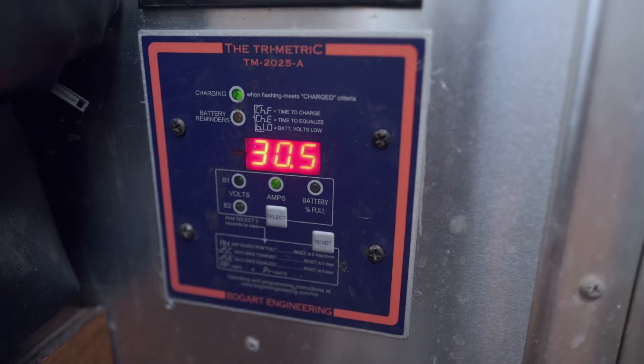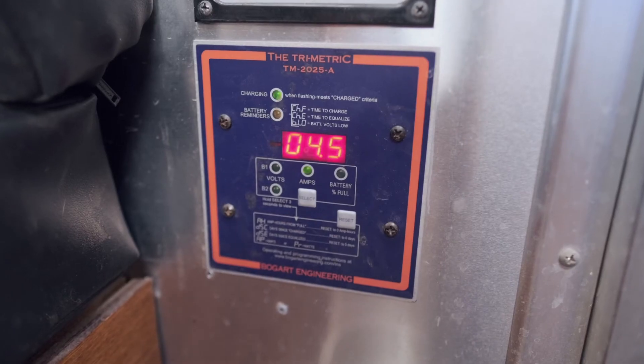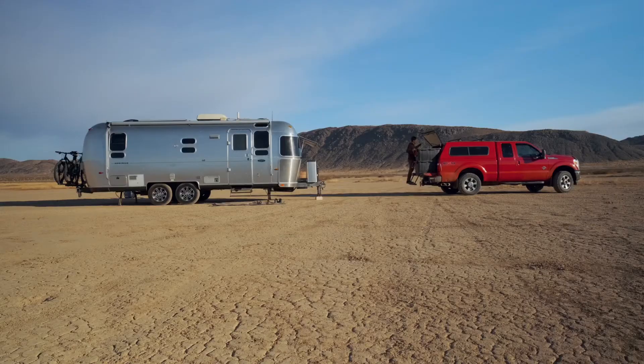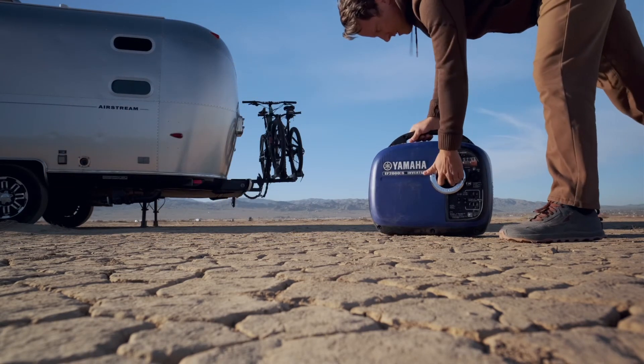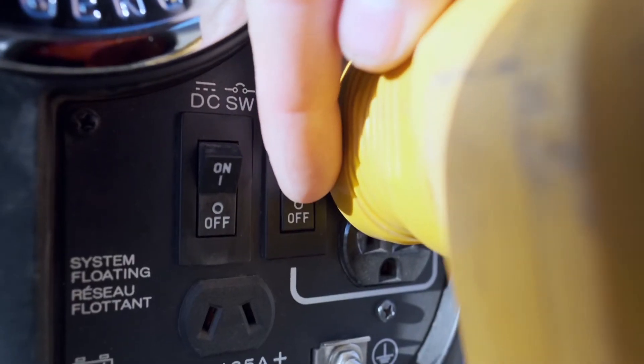The good news was there was plenty of sunshine in the desert, so with our 520 watts of solar panels on the roof we shouldn't have had a problem recharging — but we were wrong. With AGM batteries, there comes a point where it doesn't matter how many watts of solar you have, because they only rapidly charge until they're 80% full. After that they require a long, slow absorption period. You can see on the meter: in the bulk charging stage the batteries are taking about 30 amps, which is great, but after a short time they absorb less and less — at 94% full we're only taking about 4 amps. At that low amperage it takes about five hours to bring the AGMs back to 100% state of charge. In winter, the days are just too short and too cold to make up that energy deficit.